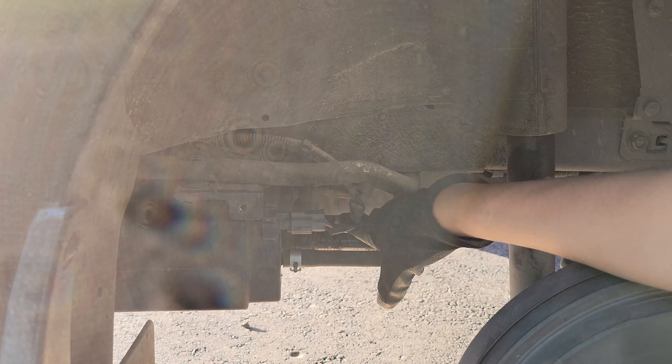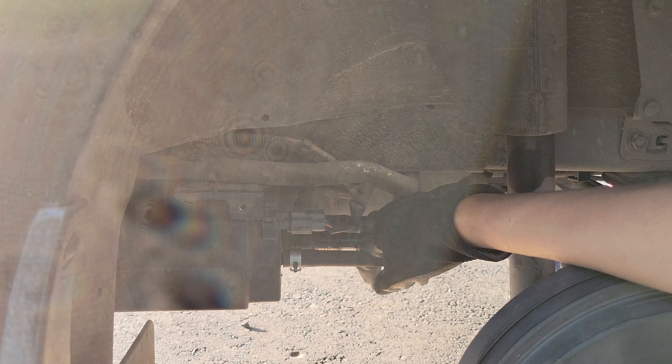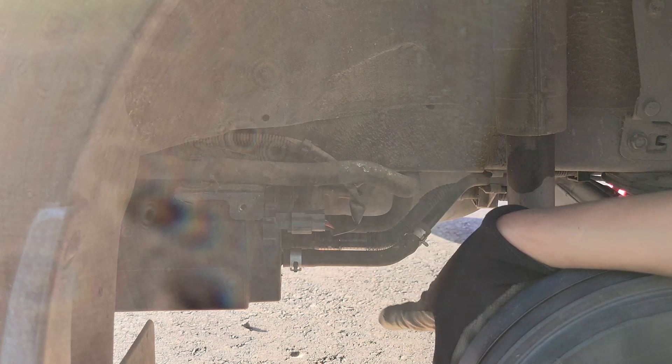There's another hose in the back that doesn't have a clamp, so you can just use a pry tool to push it off. The middle one is the most difficult hose to disconnect — it connects to the fuel tank and has two buttons you press to get it off. It took me about two days to figure out. The way I did it is I squeezed the two buttons with needle-nose pliers and then wedged in my pry tool in the gap between the hose and the canister itself, and I was able to get it off easier that way.